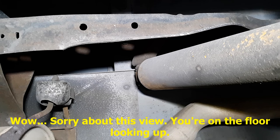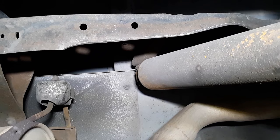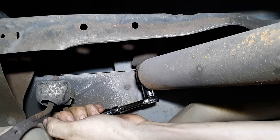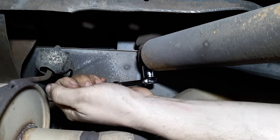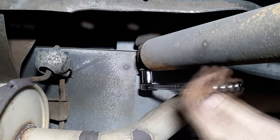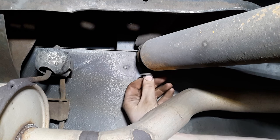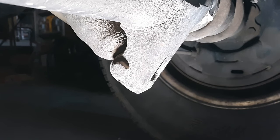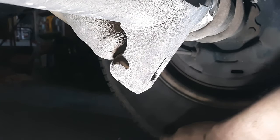For the shocks, we're going to start here in the back. First thing I'm going to do is try to get this top bolt on. Luckily, Ford was nice enough to put this exhaust pipe right in my way. All right, now to the bottom. These bolts, at least on this F-150, are an 18 millimeter. So that's what I'm using.